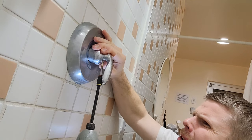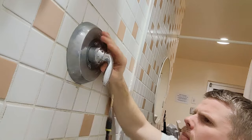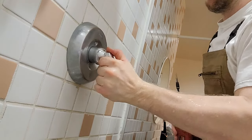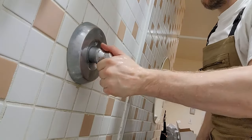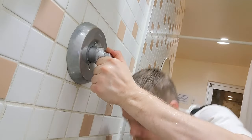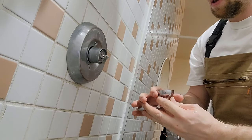I'm going to go back and drill just a little bit more here, and you'll see I'm sort of rounding it a little bit with the drill just to make sure I get all of that screw out of there. It's starting to wiggle a little bit — I just need to get a little more leverage so I'm going to get two hands on it and really pry it off. When you start seeing it wiggling and coming towards you, you know you've got the screw out and you just have to use brute force at that point.